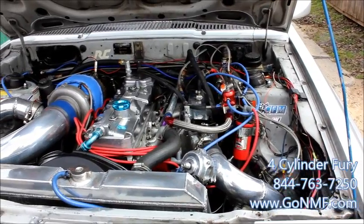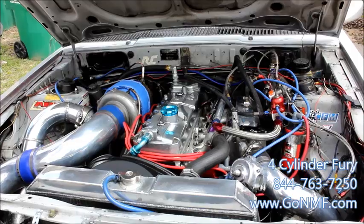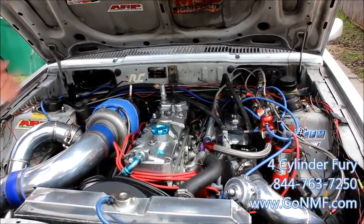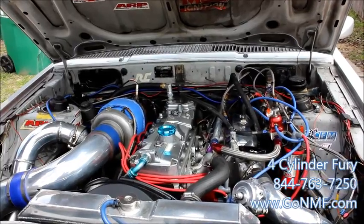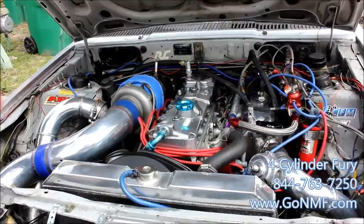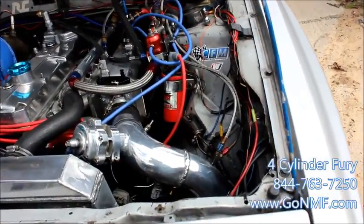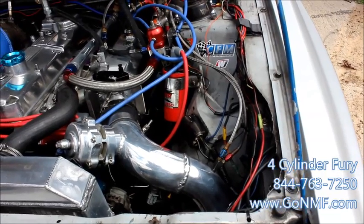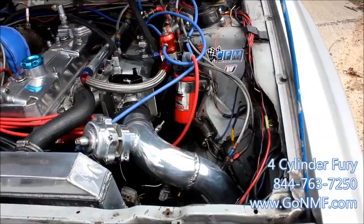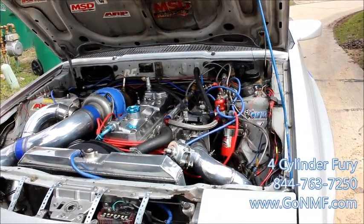As you can see, I run a 62-66 turbo. It is multi-ported with four injectors. I run on E85, which helps keep it cool. And I do put NMF in my water — it also helps keep it cool — as well as in the oil and the transmission. I do have my nitrous hookup, but since I've been using NMF, once my bottle runs out I can still spool my car without it. It's pretty much just a show thing right now. I can actually save $40 every time I go racing because I don't have to fill the bottle up anymore.